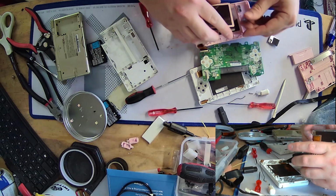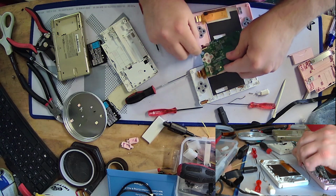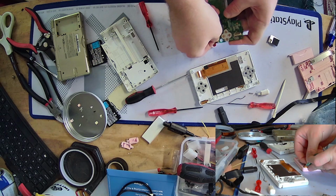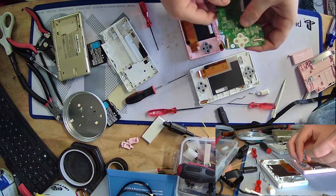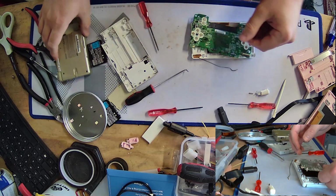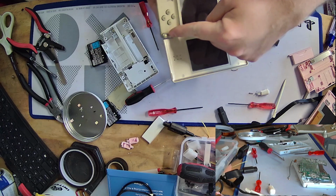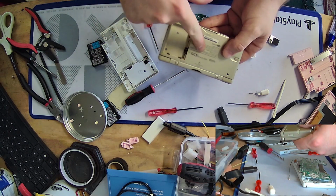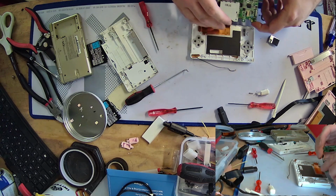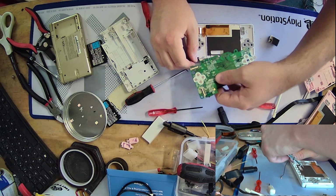And it's not even really because it was poorly built or anything. Actually, I think the opposite is true. I think it's a giant pain in the ass because it's too well built. The biggest problem I have with doing top screen replacements is simply the fact that in order to get to the top screen... Here, let me use this one so all the buttons don't fall out. You have to undo these 4 screws here, easy enough. And then the cable is routed in a very specific way through the middle. It goes through this hinge and comes down over here. And frankly, I can't be asked to deal with that. That's just too much. So, board swap it is. I would much rather put up with the frustration of a full board swap.